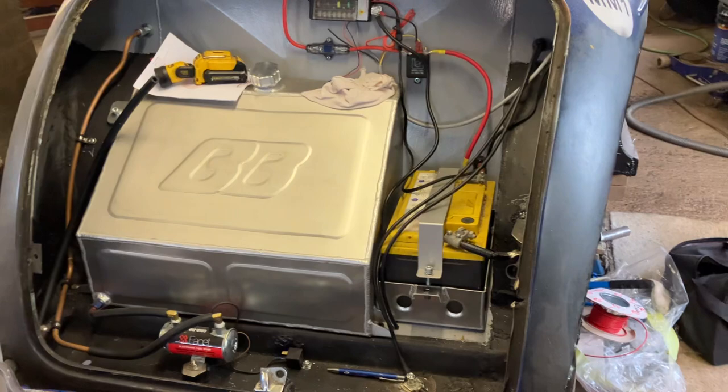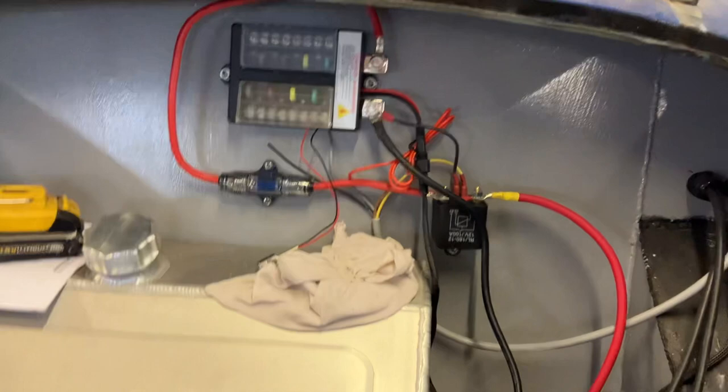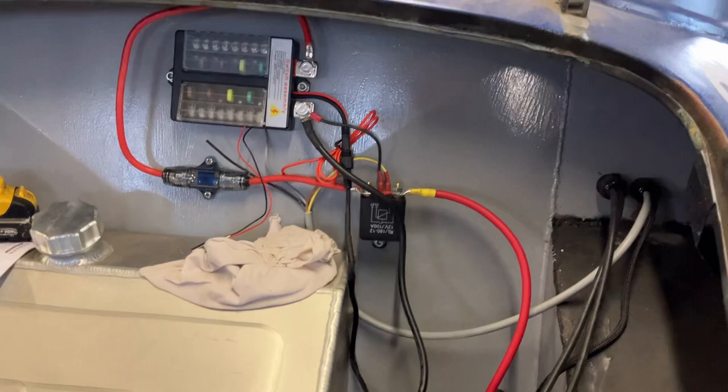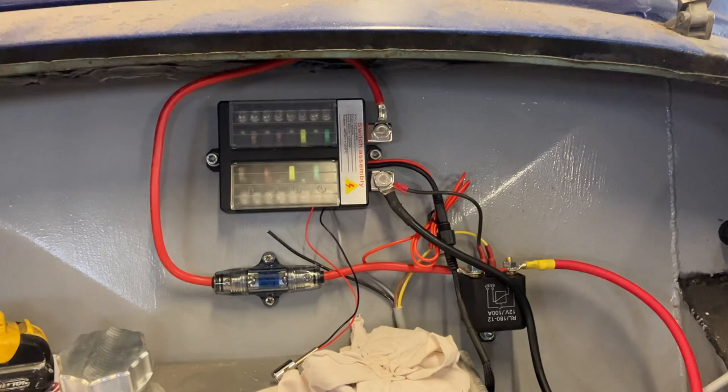In the boot, I had this lovely fuel tank made by Bennett Built as well, along with the battery box. The fuel pump is mounted, and there's the control box for the switch panel. I've started doing a bit of wiring — just doing testing really, making sure everything does what I want. That main power switch leads straight to the 100-amp relay, which will then give power to everything in the car. If I have a problem, I'll flip that switch and it will turn the relay off, turning everything off.